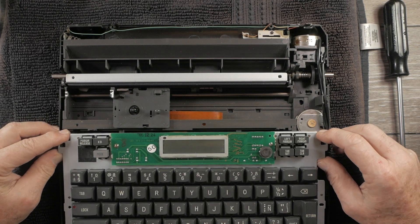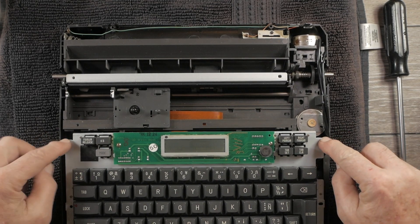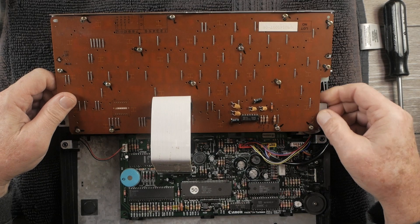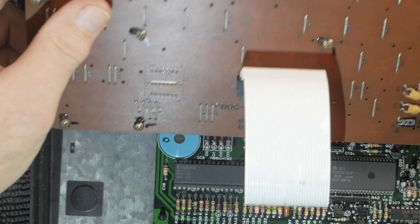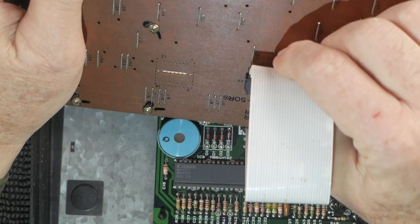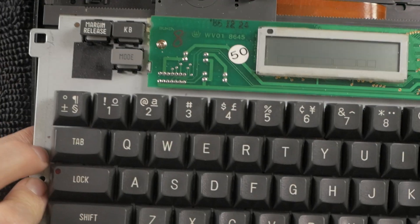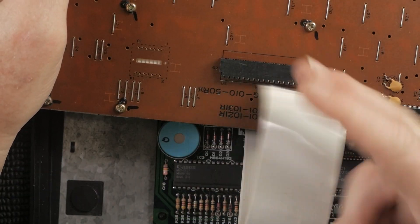What we want to do is remove this keyboard — it just lifts off, mounting onto four studs, two studs here and two holes here. You'll notice there is a ribbon cable that goes onto the circuit board. This ribbon cable connects into the motherboard and just pulls straight up — start from one end and it removes right off the connector. When you put it back, remember that it goes straight over; the ribbon does not twist like a Möbius strip.